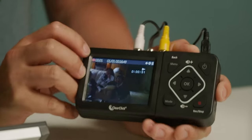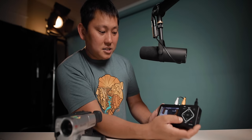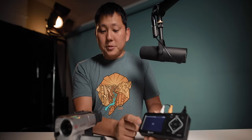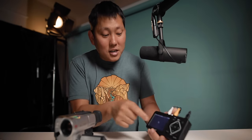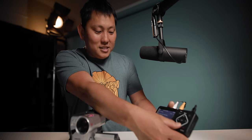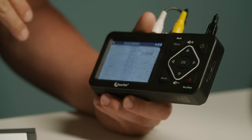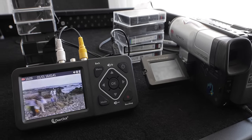Now, some of the specific issues I had with this thing. My biggest issue was files getting corrupted after capture. If the signal gets interrupted — like if you pull out the cable, or sometimes at the end of a tape — you can corrupt the file. There'll be a little sad face on the file meaning it's corrupt. So if you're capturing a clip for an hour and something goes wrong with the connection, you end up with a corrupt file. The most frustrating part is the signal can get lost whether it's a slight disconnection or tapes skipping because they're so old. Go into the menu and enable signal loss detection, but even after that, files still can corrupt. Best practice is to stop the recording before the tape ends — it's an extra step, but as long as you stop it yourself, the files have been good.